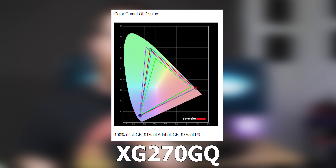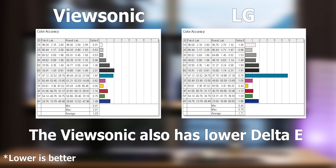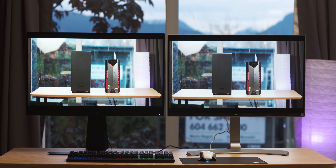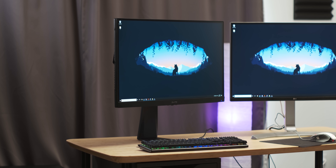And that 1% really means the world. But it goes further than that, because according to the SpiderX, the ViewSonic display hits 97% of the DCI-P3 color space — which is like a super wide cinema color space — whereas the LG display only hits 81% of that. For an internet content creator that difference doesn't really matter, but it shows that the ViewSonic display is quite a bit more color accurate. Although there is one place where the LG monitor beats the ViewSonic hands down, and that's screen uniformity. The maximum deviation in brightness on the ViewSonic monitor is about 16%, whereas on the LG monitor it's 10%. Bear in mind though, this does vary from panel to panel, so you can have three of the same monitor and they'll potentially have different panel uniformities.